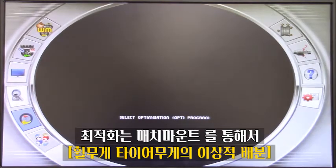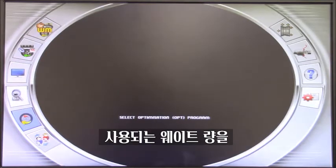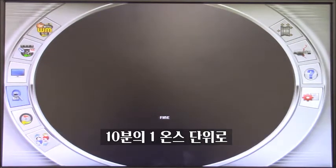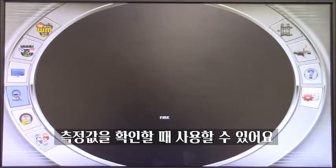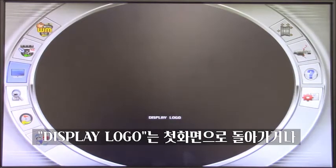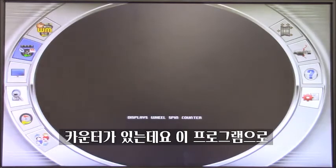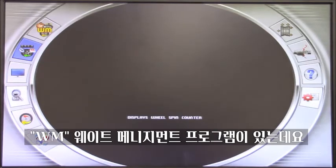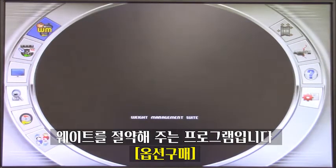Optimization is the program that allows me to basically match-mount — spin the tire inside the wheel and find the least possible amount of weight in order to balance it. We have a fine reading, where we can quickly see the unbalance in very fine increments, meaning gram by gram or a tenth of an ounce at a time. We have a display logo that takes me back to the main page or screen saver, a counter to see how many wheels have been spun daily, weekly, or over the total life of the machine, and a weight management program that helps save weight without compromising the balancing of the wheel.